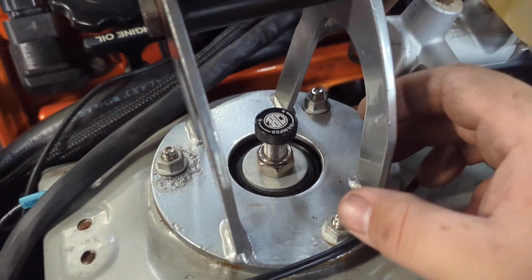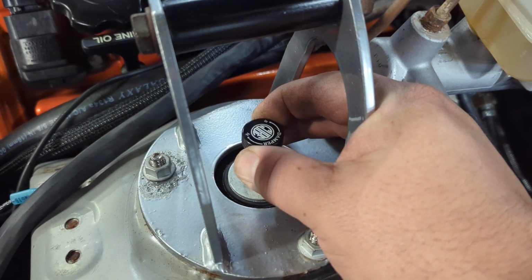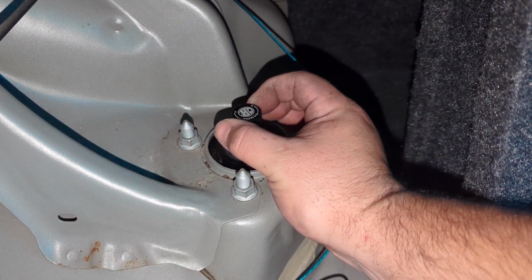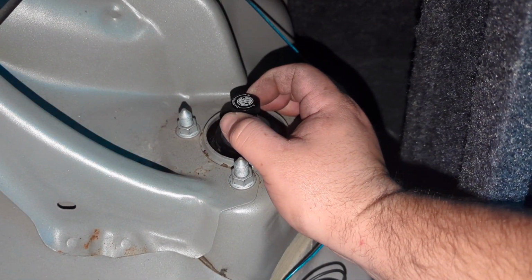So I was very happy with the way this rode. And this is me just being picky, and because I have the adjustment available to me, I will adjust it. But honestly, if it did not change at all, I'd be totally happy. But I'm going to make the front 1 click softer. It probably won't even do anything, but I'm going to do the front 1 click softer, and then actually the rear I think is a little too soft, which is a good thing. I was afraid it was going to be stiff as hell. So I'm actually going to add 3 clicks to the back and then see how it drives, and we'll go from there. So on the front, I will go 1 click to the soft side. And for the rear, we'll go 1, 2, 3 to the hard side.